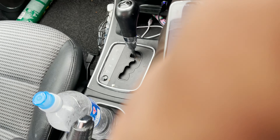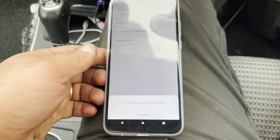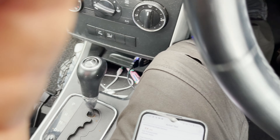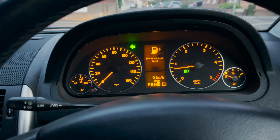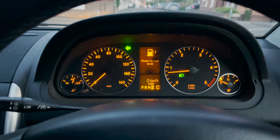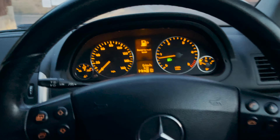Ignition off - try not to make the same mistake again. Ignition on all the way. There we go - we have the steering angle there, which doesn't seem to change on the figure. I tried to do the road test procedure with the Thinkcar but it didn't work out - I believe it was because when you press road test it doesn't actually see the steering angle sensor. So I got the Autel back and did the procedure. I don't have the GoPro filming but I'm just going to drive a little bit - the girl lives around the corner.